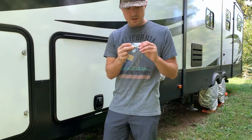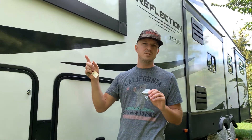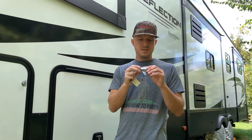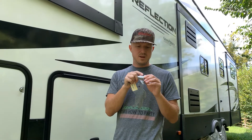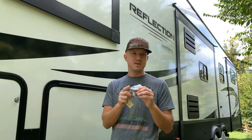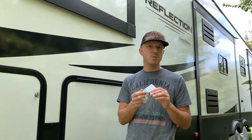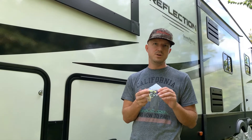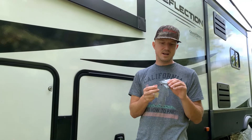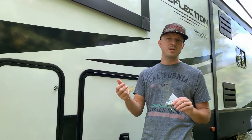The key point when you get the tumbler locks is measuring, because depending on whether you're doing your basement door or your kitchen door, the lock lengths are the most important thing. They're measured from the tumbler face out to where the lock mechanism is. In my particular unit I needed a 7/8-inch long one and a 1-3/8-inch long one, but your unit could vary. The only way to really know is to actually take your existing tumbler lock completely out of the door.